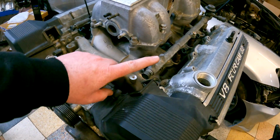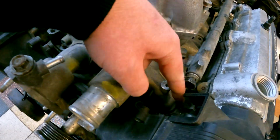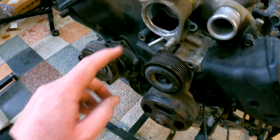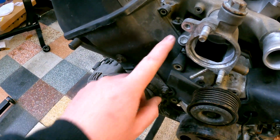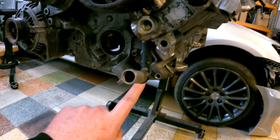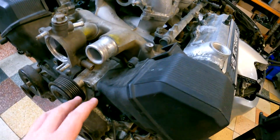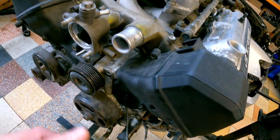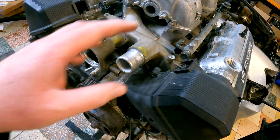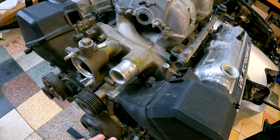Now then, there's a section here, there's 2 grey plugs that live here. That is another section of harness that comes down here, along here, and it goes off to cam sensor there, cam sensor on this side over here, comes to your coil, which lives here, and it comes down to your crank sensor that lives down in here. So that's your second section, comes off there. We like to have that one because when we build the harnesses brand new, because we don't use the old harnesses, we build them all brand new. Obviously this becomes one harness, so it's no longer split into all these different sections.